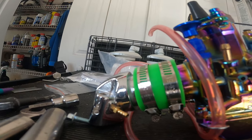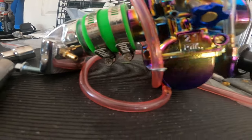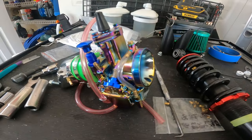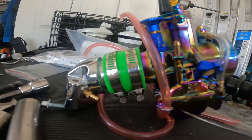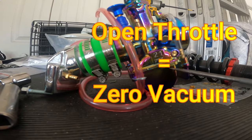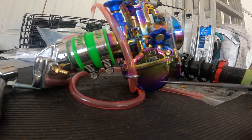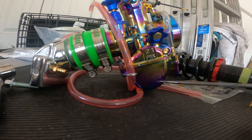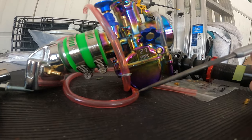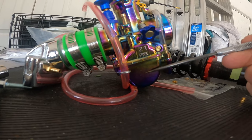It's going to shut fuel off. It's only pulling fuel out of the float bowl. Vacuum pumps work great. It doesn't matter to me, honestly — whether they're Mikuni or Chinese pumps, I've used them all. They work good and they pump a lot of fuel. I've got videos showing they way out-pump an electric pump, but they've got to have vacuum to do it. We've pumped our float bowl full, we're sitting about right here, and we drag race our buddy. Vacuum pump has stopped pumping fuel — you've got no more fuel coming in. Light turns red, you get to about right here on fuel, you let the throttle off. As soon as you close that throttle, you're making great vacuum, especially if the engine RPM is high.